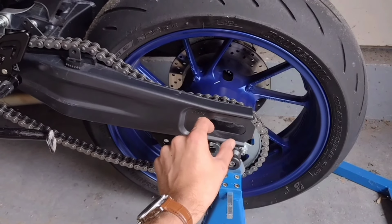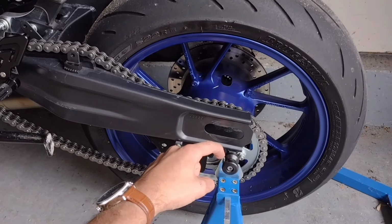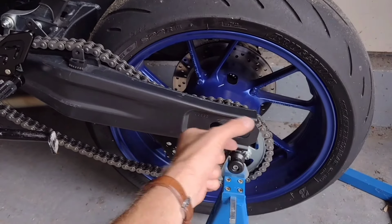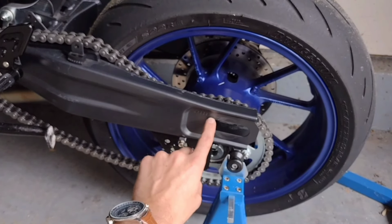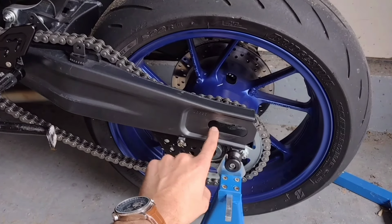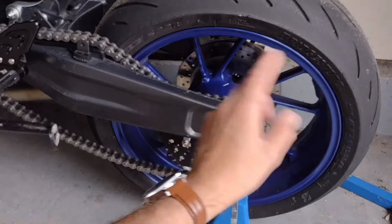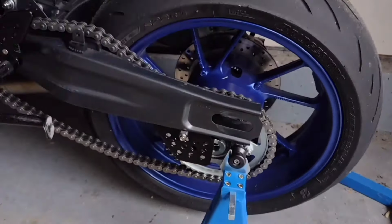I've bought a different nut, and then I've got a secondary locking thing that I'm going to do. So I'm going to show you all of that, and we're also going to try to make these metal plates that hang around on the front here, the ones that show you the alignment guides, those star-shaped things. I've modified them slightly so that they don't fall off once you pull the axle out, and that's hopefully going to help us make quick changes of the rear wheel for track use, etc. So stick around and we'll show you all that in this video.